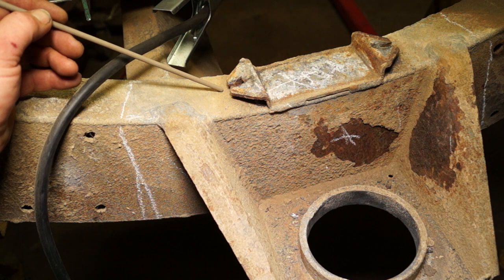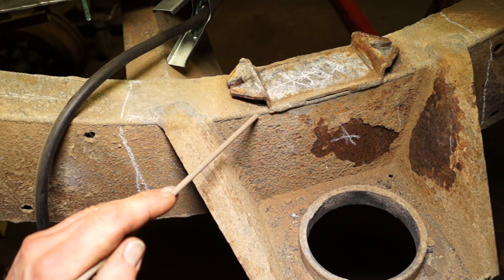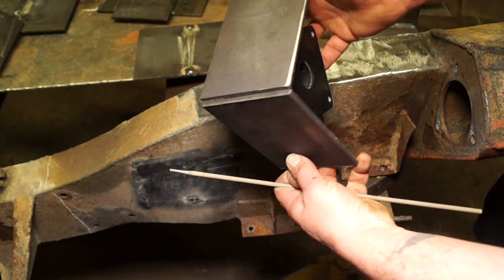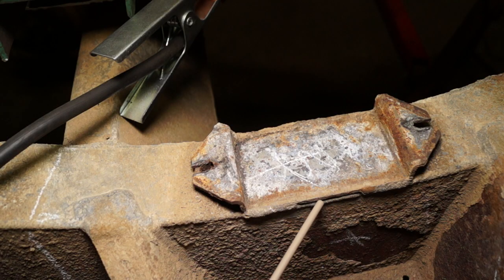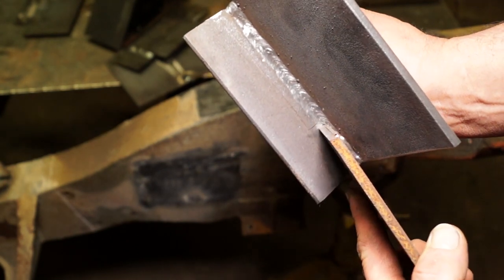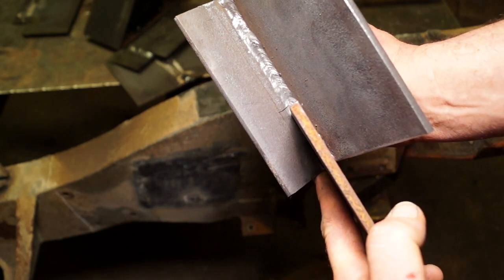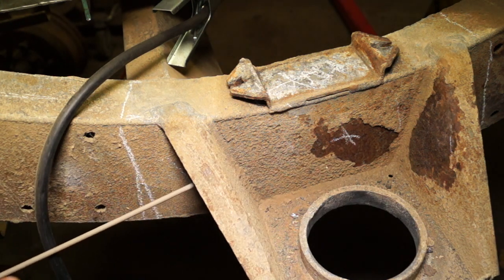The chassis rail on your Land Rover has a seam along here because there are two sections welded together. This one has an edge weld — that's two pieces jointed together like this — so we're looking at using this type of joint on the chassis. The bump stop also has edge welding, done at a lower voltage. For the fillet weld, as I'll show you here, it's the same thickness as the steel being welded — I've got a five mil piece of steel that covers the weld nicely, done on five mil plate.